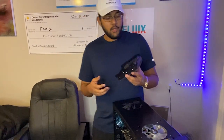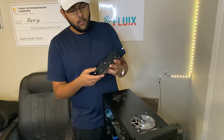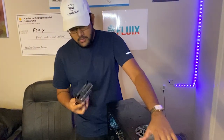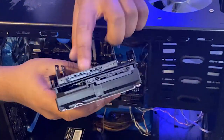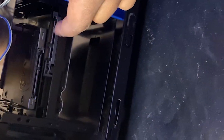To mount our hard drives into the case, I'm using this bracket from Corsair. I have my SSD plugged into the top and my hard drive connected to the bottom of the bracket. I'm going to use this bracket to put it into the hard drive bays right over here. One thing I'm going to make sure to do is have these SATA and power connectors come out to the back of the case so I can route the power easily from the back and hide the cables.